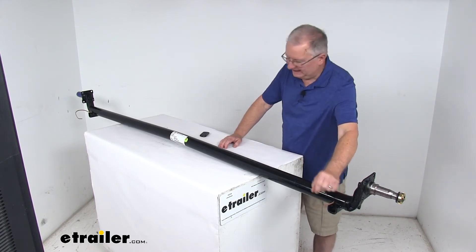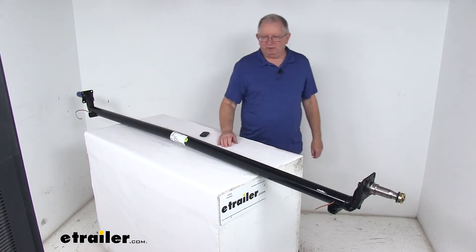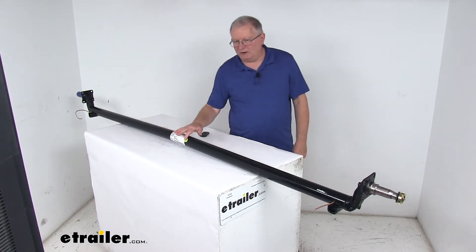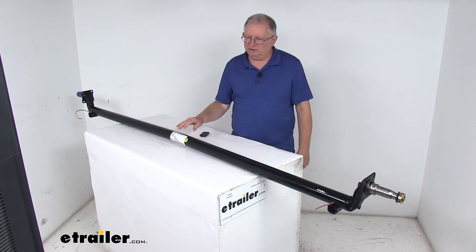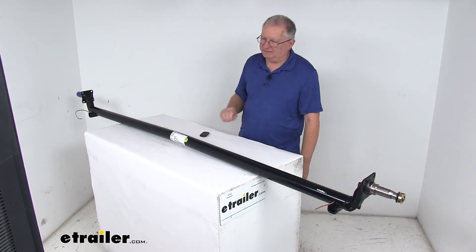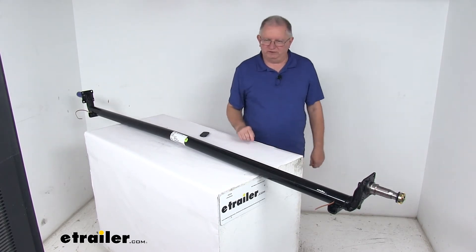You have wire on both ends that goes through the axle — that's the wiring for your electric brakes. The label right here on the axle should usually face the rear of the trailer when you install this. If that label happens to be missing, then those wires that come out for the electric brakes should be facing towards the rear of the trailer.